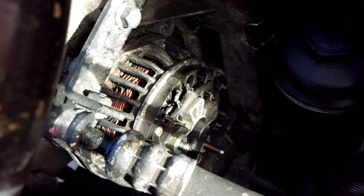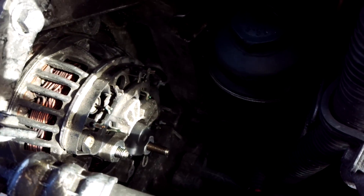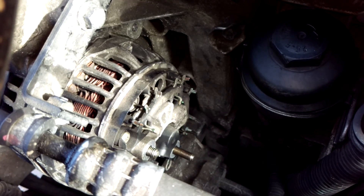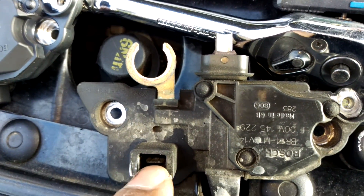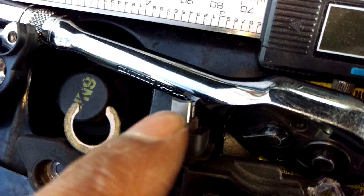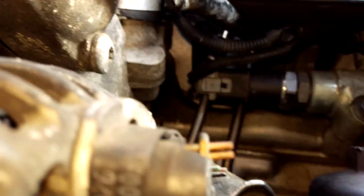If you've seen part two of my video on diode pack testing, this is the diode pack — or rectifier — here on the right, which is made up of the diode pack. I'm going to get a Dremel wire brush on the contacts here and just clean all of those up. The diode pack is fine — if you want further details on testing that, it's in part two of this series. The thin wire plugs in there giving battery voltage into the alternator, and that's transferred via these brushes to copper slip rings inside the alternator — and you can see the slip rings just there.